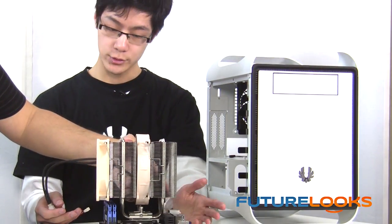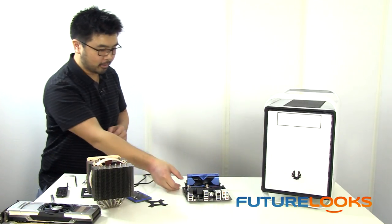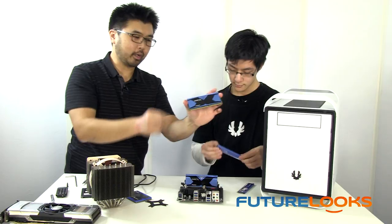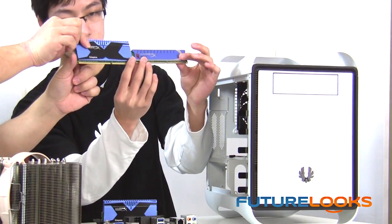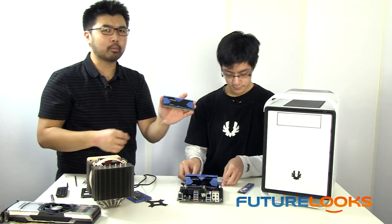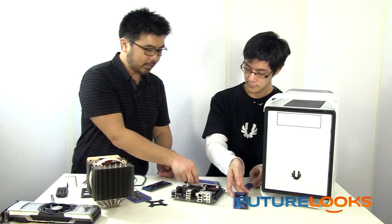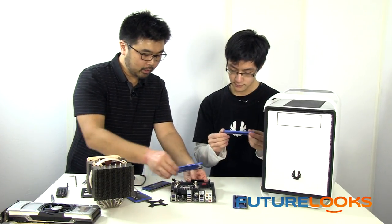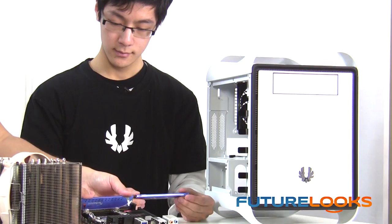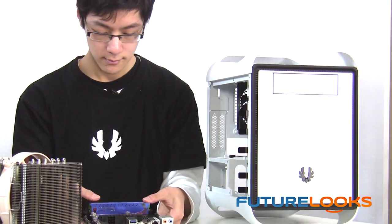So what do we do? We'll switch out for shorter RAM. Let's bring out some backup RAM — we've got some Kingston HyperX Genesis modules, which are actually half-height. You can see how short they are compared to the Predator. There are also some even lower profile modules from Samsung that have just hit the market. These HyperX Genesis are an 8GB kit at 1600MHz, pretty standard. The EVGA Stinger will actually support memory up to 2133MHz at 1.65V, and you can go up to 16GB in higher densities.